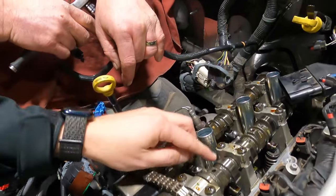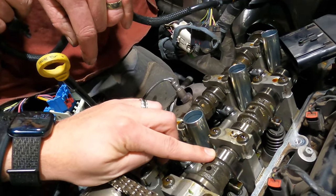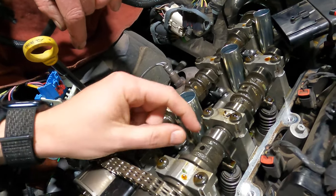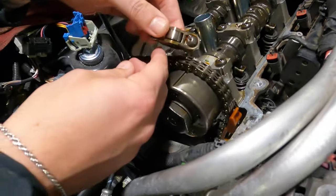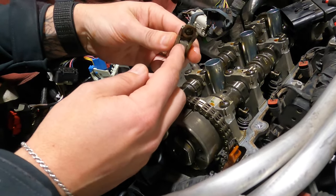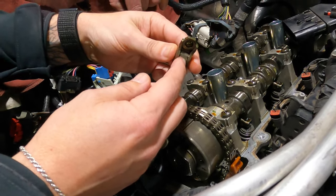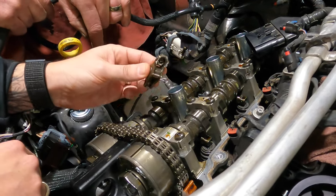See the scoring on the camshaft right here. This will eventually turn into the issue we saw on the other cam — it'll wear down on the sides where the rocker roller contacts it. This is your standard rocker roller. What happens is the bearing in here goes bad, so this is the only part riding on the cam lobe, and the sides of it are wearing down grooves on the outer lobe of the cam.